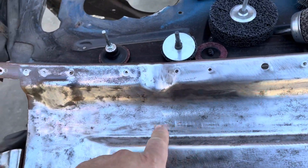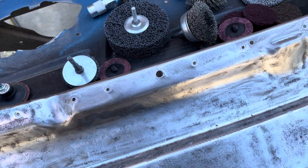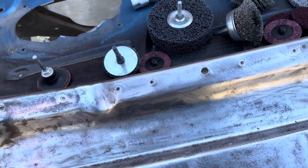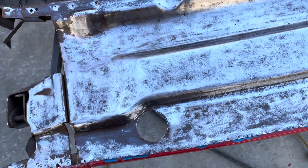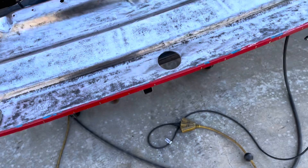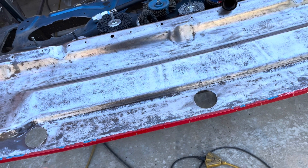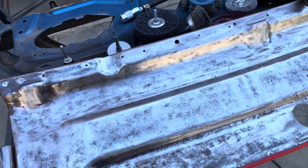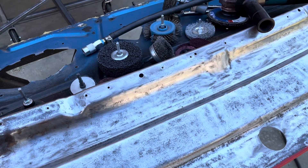You can still see these small pits that it just didn't quite get down into. I can probably go back over this with the wire wheel. I learned something from Sylvester's Customs — if you guys aren't subscribed to him, I would highly suggest it because he's really good at what he does and does it for a living. Basically what I learned from him was that you've got several different ways you can take the rust off. You can do it mechanically, or you can put phosphoric acid over it. He uses phosphoric acid and then some kind of metal conditioner, and that's the way he likes to go, and it looks like a pretty good way.